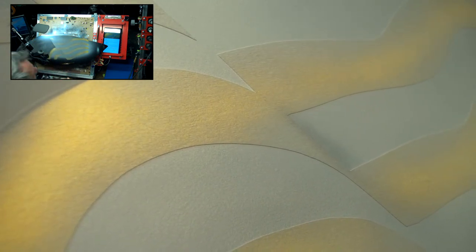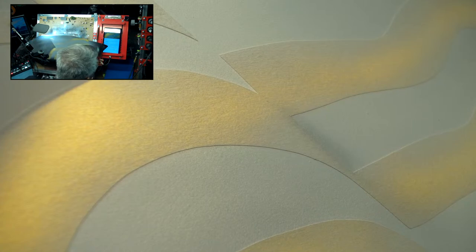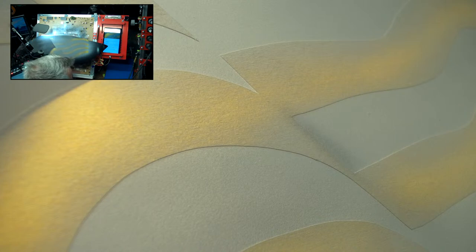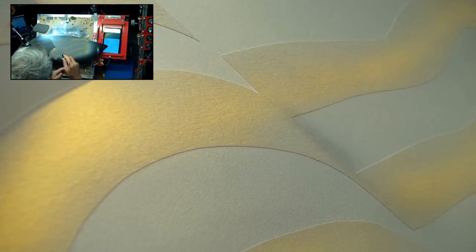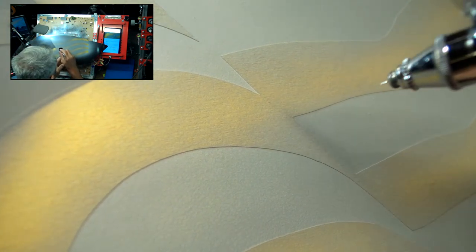That's better — you get a much closer look there. Simon asked what green was added to Candy Black and how much — it's probably better if I post the actual formula, but it's just Candy Emerald Green. So it's Candy Black and Candy Emerald Green, and I might have added a little bit of blue to it, but I don't think I did. That's what I did to make it into this Slate Black — it just cancels out the purple in it.